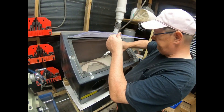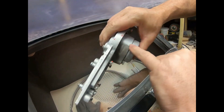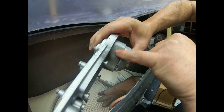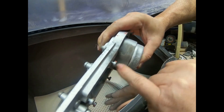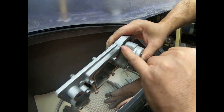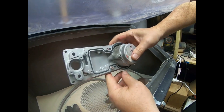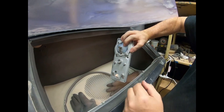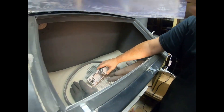Here's an example of how much scale actually gets on these things. Look at that scale — it builds up in them. That's the anodizing there underneath — you can see the black. The aluminum gets anodized and scaled, and then it doesn't transfer heat. After three, four, five hundred thousand miles the actuator might start going bad because it just can't transfer or wick away the heat from the turbo. So that's what I'm doing — protecting it from getting any dirt in the motor while I finish sandblasting it down.